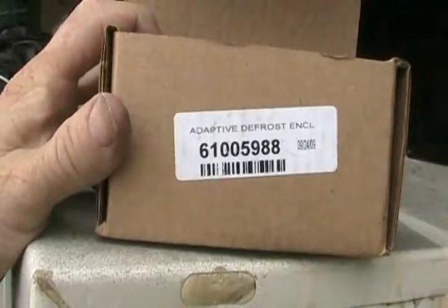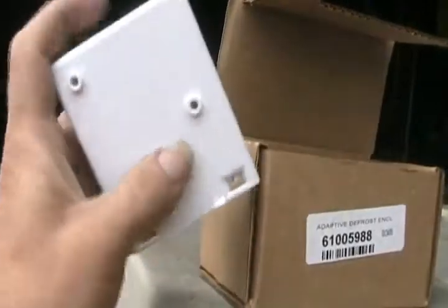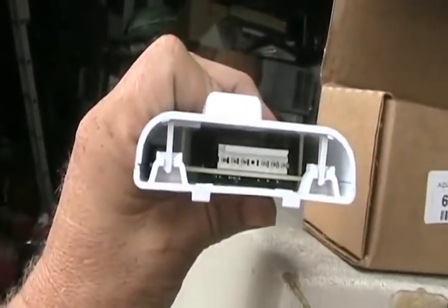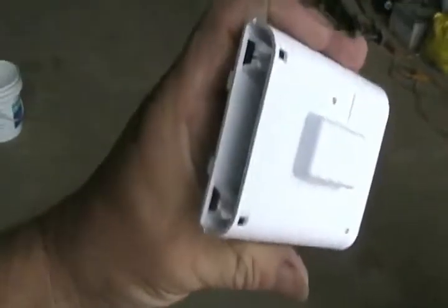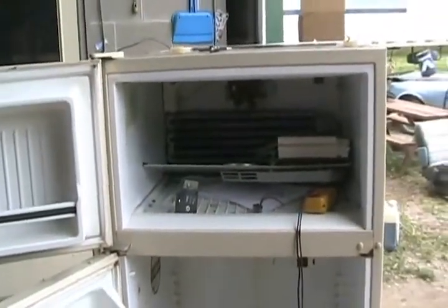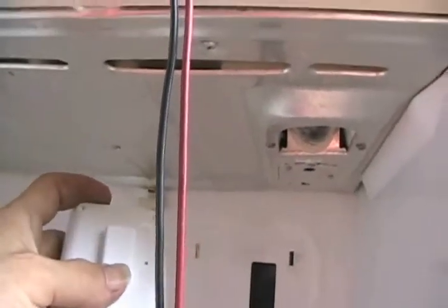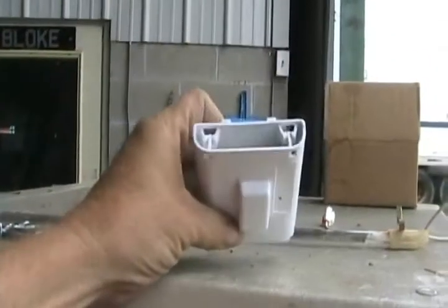There's another kind of fridge timer called the Adaptive Defrost Control — and it's a piece of crap. They come on high-end Maytag fridges and some other high-end expensive fridges. It's just a little circuit board that does the job of what should be done mechanically with the old-fashioned type of timer. These things break down all the time. They have nothing to rotate or bypass to make them switch to defrost cycle or compressor cycle. In side-by-side fridges they're hard to find — usually on the upper part of the fridge inside a great big plastic cover with big wheels, air doors, lights, and controls way at the back, completely out of sight. These pieces of junk are really expensive too.